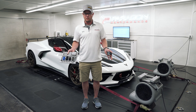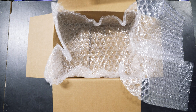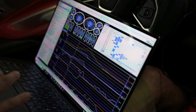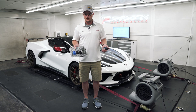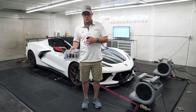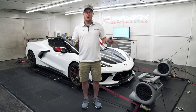We've been waiting for this for a long time, and HP Tuners surprised us recently with the ability to send in the ECM, have it unlocked, and now fully tune it ourselves with the MPVI3. What that means is we can now customize the tuning on these cars for different fuel types, different conditions like racing, different bolt-on modifications, even cams, boost, and everything. It's now possible for us to actually tune these cars the way they need it.